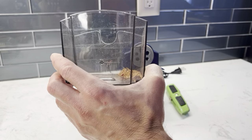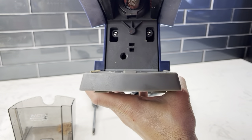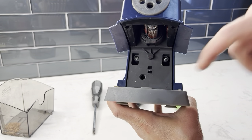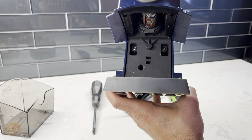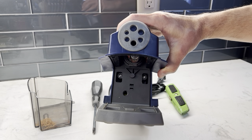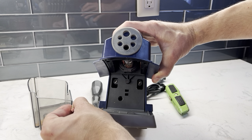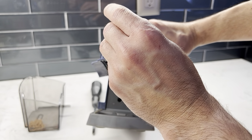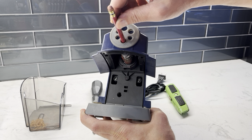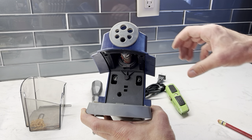Obviously you start by taking the shavings tray out. Inside this hole right here and on the backside of this tray is a little nub, and that is actually a safety switch. So if you don't have the catch tray inserted, this isn't going to run. There are actually two safety switches: one for the nub on the tray, and the other one — you can hear the click of the pencil going in and out — that activates the motor. But the motor won't run unless the tray is in activating the switch.